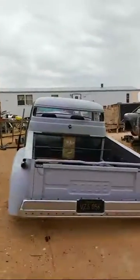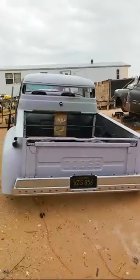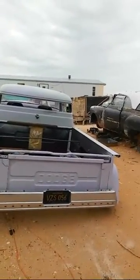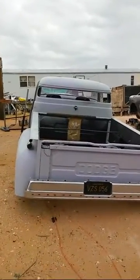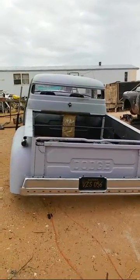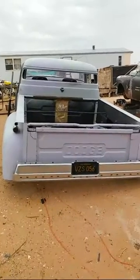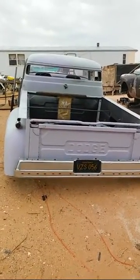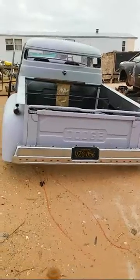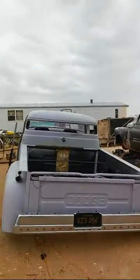Again, it's an '89 AOD 5.0 out of a Lincoln. It ran perfect, it shifted like butter. It was badass, and we just changed the fluid. Boom, it's not working. It just won't shift out of first. I'm hoping it's a speed sensor because I already cleaned the governor, checked that the TV valve wasn't stuck, and checked the adjustment for the TV valve in the cable, and it's exactly at no pull and no let off like it said for the specs. We also put in a new TV valve grommet, so all that's in spec. The governor's not dirty. We cleaned everything. It's still not shifting. Let me know. I know it's a known problem out there. Thank you.